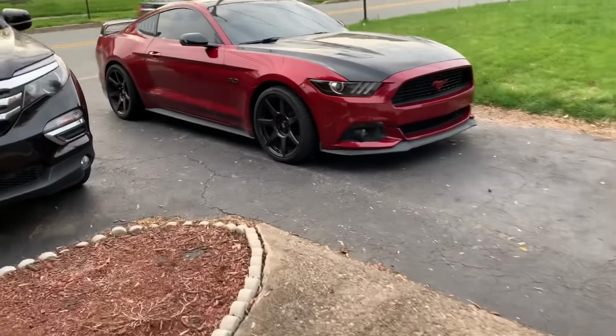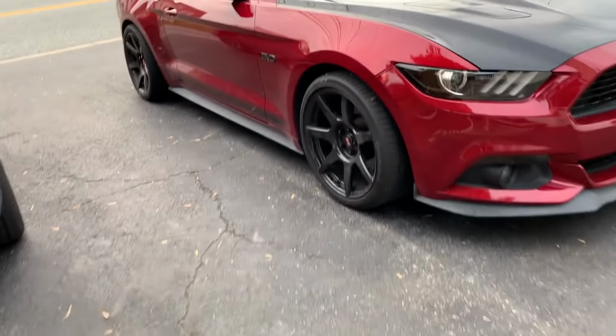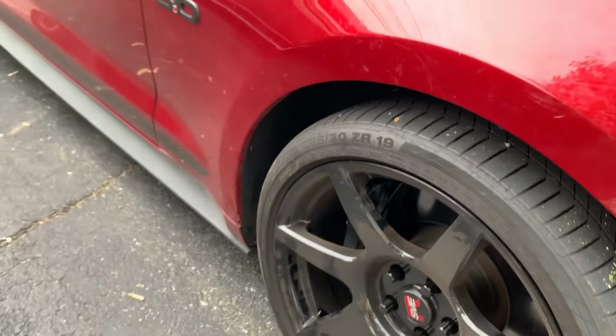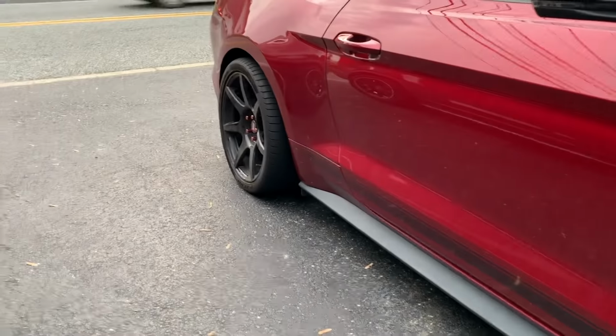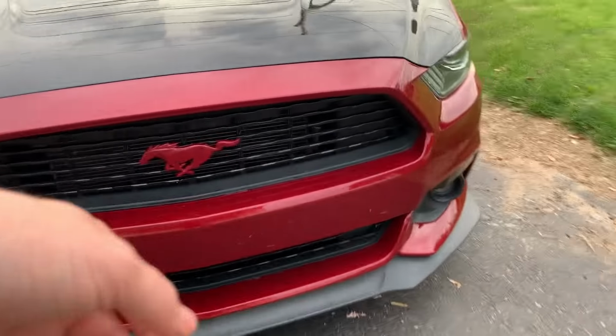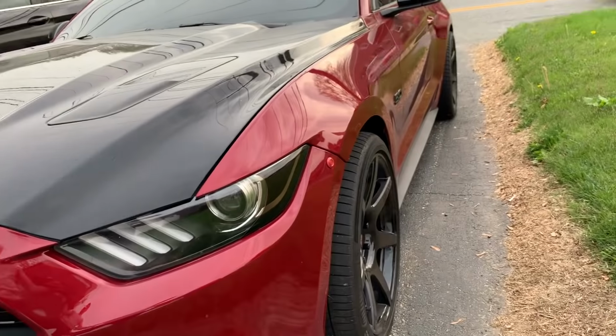Well, as I suspected, I set the height way too high. We're looking at like 4 fingers, and it definitely doesn't pass the shoe test. And same thing in the back. So I'll have to lift the car back up and adjust the height all around. But that is for tomorrow. I think I've accomplished enough work for the day.